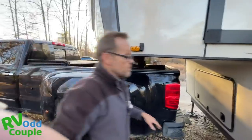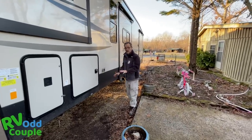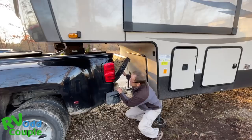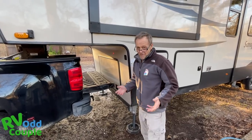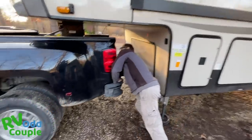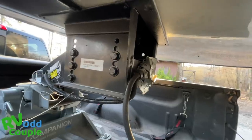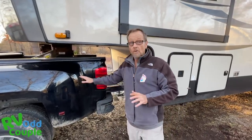If you look back at my RV, you can see it's tilted on the grade, but I've got my wheels chocked and my landing gear is down on the ground. Now it's okay to pull away. When I go underneath to drop my gate, I'm going to stay low — if anything goes wrong I can get out of there quick. I drop my gate. Next thing I need to do is remove what I call the umbilical cord — some people call it a five-way, three-way, or seven-way. Stay low, reach around the corner, remove this, make sure it's clear and won't get hooked up on anything.